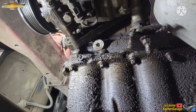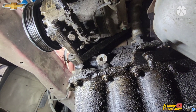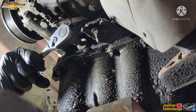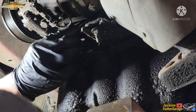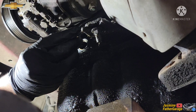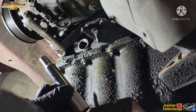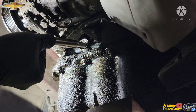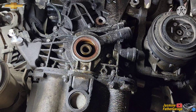We may have to take that AC pump off the bracket, so let's see how this thing goes. That's loose now — we're going to use our hand to take them off. This is the pin that we're going to slide in here. I'm going to put this crank pulley back in there and then try to wiggle the crank to see if it's locked for sure.